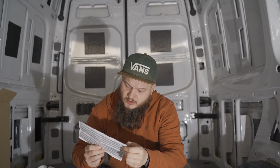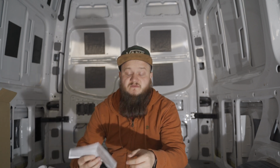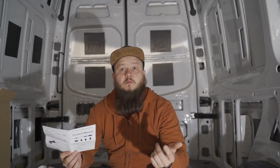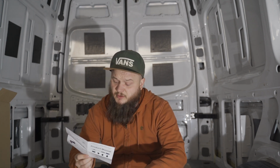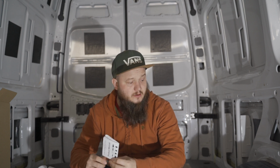With the video monitor cable, strangely it does not have, it might be in the monitor box, the monitor wiring in, but we're gonna have to find a positive and a negative somewhere there. Potentially I don't want one that's running all the time, so I might take it off the reverse there, or take it off a cigarette lighter or radio. We'll see eventually what I'll do about that. First today I just want to pre-wire the lead, find a place for the monitor, and see what I can do about that. What else did I get?